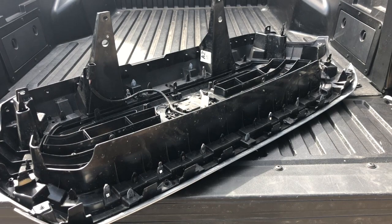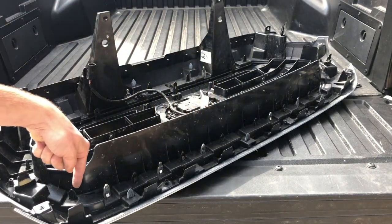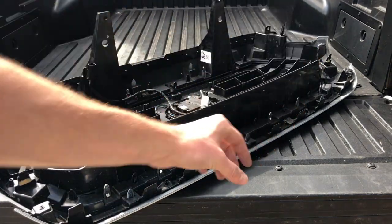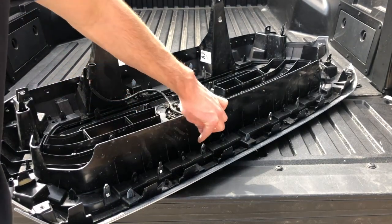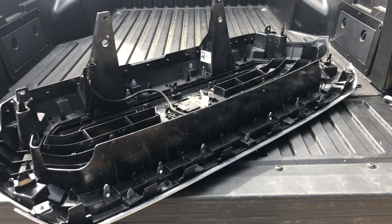There are a total of eight little screws that are all around this perimeter, and what that is doing is holding around that little chrome bezel. All you need to do is take those out, and then we're gonna start working out the chrome clips, and then we'll be able to take the chrome bezel out.